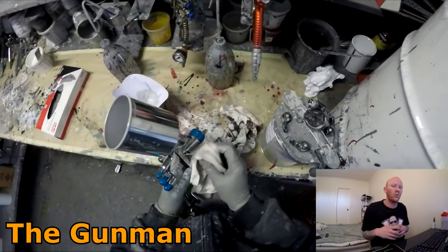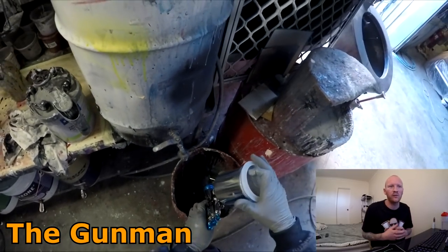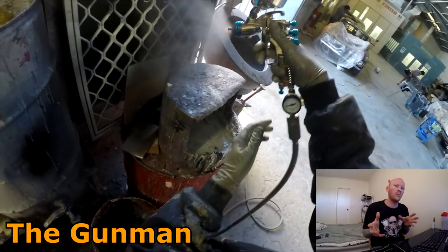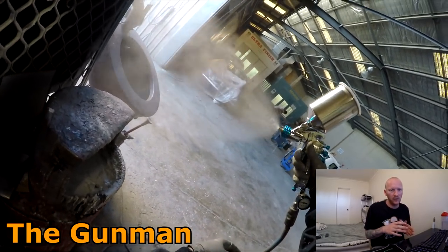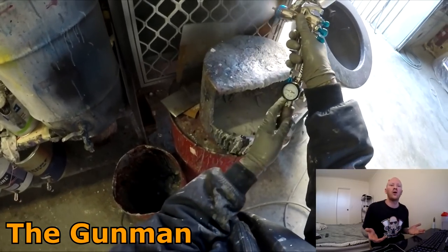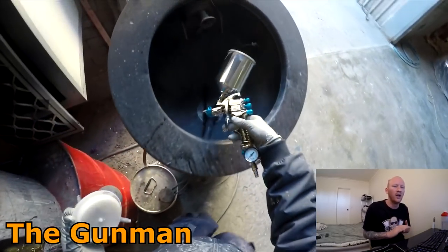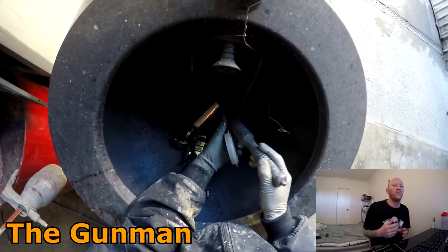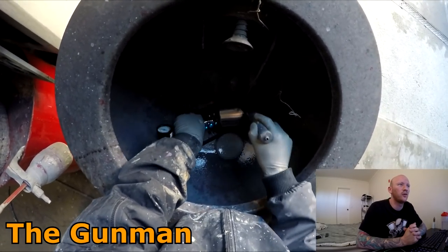When I think of primer I think of two-pack high fill, high build primer on filler repairs. What I was using it for here was mainly just a primer surfacer on a door. The panel came in, got primed with a 1.8 mil, but the repair wasn't quite right. I blocked it down, put a little bit of filler in it, finished it off to 320 grit, then put two coats of 2K primer on it. For real full high build primers I'd recommend 1.8 to 2.2 mil.